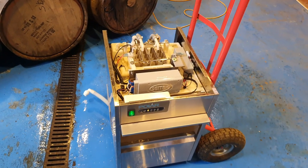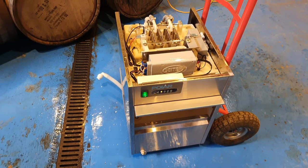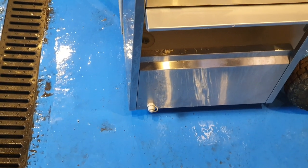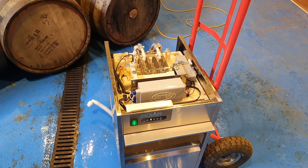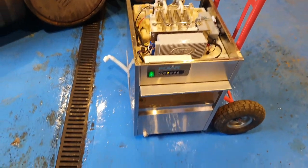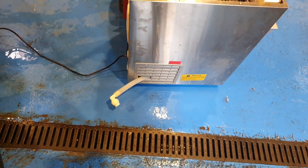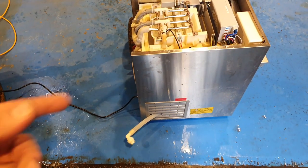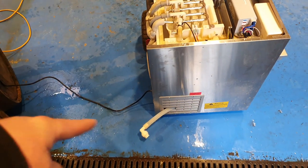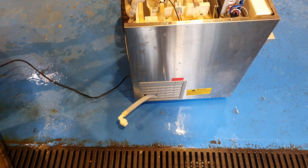While I'm at it I've pulled the ice machine out, whipped the top off, brought it down to the unit, and we've made a few modifications — giving it a clean with some caustic. That little drain plug on the front there was at the back of the machine, believe it or not, which made it very very difficult to empty after a cleaning cycle. That's a barrier that prevents people from actively wanting to clean it. So I've moved it to the front — it was just a quick case of rerouting a pipe. Also with this little section on the side, that was the drain valve outlet pipe for draining, because this is a mains supply ice machine so any overspill just went down that drain.